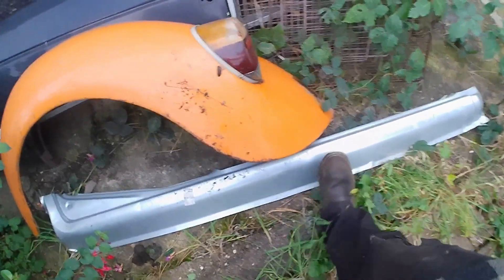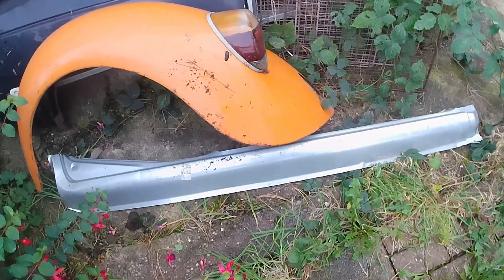So there we go - there's a complete sill. Just need to order the other side to get that sorted. Quick summary: the Suzuki Wagon R, aka Purple Slurple, is going to need both sills doing - both inner sills - and the entire interior has to come out in order to weld them, because the last thing you want is the heat from welding setting fire to the carpet. I've seen it happen to quite a few people who thought they'd get away with it and the car burnt to the ground. If you like this kind of video give it a thumbs up. Like, share, comment, subscribe - you can also check me out on Instagram, Twitter, and TikTok. Until next time folks, have a good one.